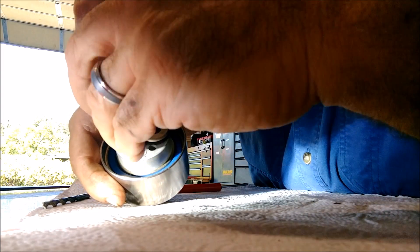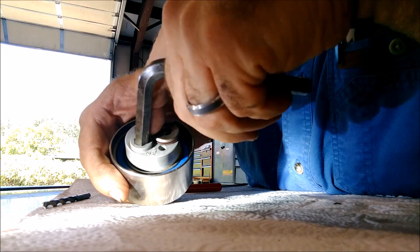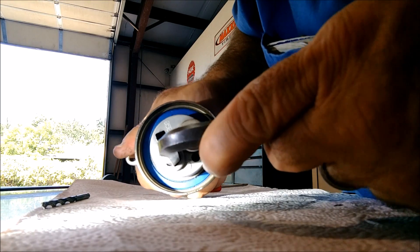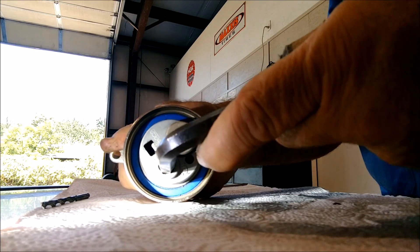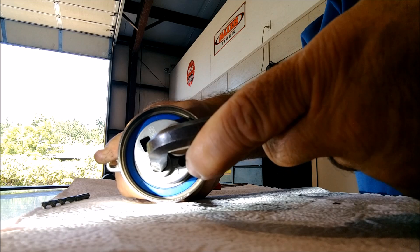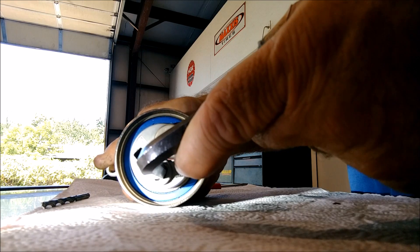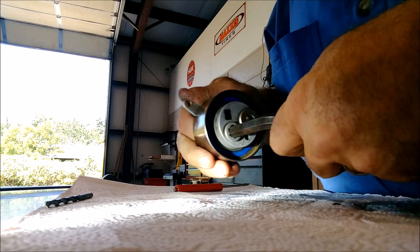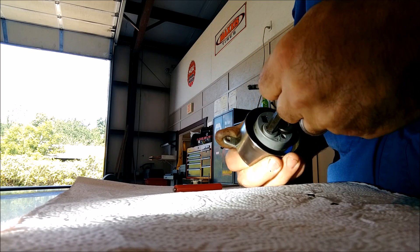You'll need to get a suitable Allen head that'll fit in here and apply very light, steady pressure until it rolls back. When it does, this window will open up. It took me about two minutes to get it to finally slowly go back and slowly release the pressure. Once it's like that, you put your 5mm holding tool in there. I had it working a second ago — I think the tension's come back out enough that I can't set it back in, so I'll have to reset.